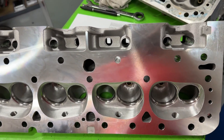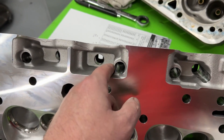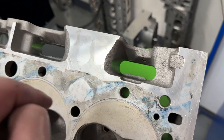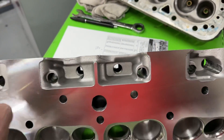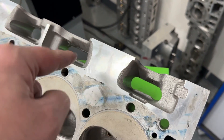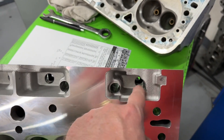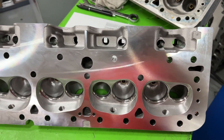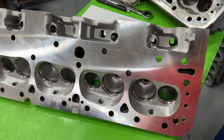Another obvious cost-saving difference is machining time. You see these round holes around the pushrod slot — notice on the RPM head. I'm fairly certain they probably started looking like this, and what they did is they took an end mill and just ran it over on the machine. You wouldn't think it's a big deal, but it's machine time. If you get a head off the machine quicker, a company can make more money by putting another one on — so it's probably another way they saved money.